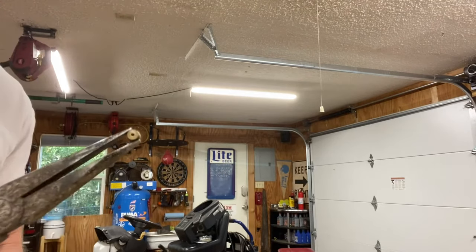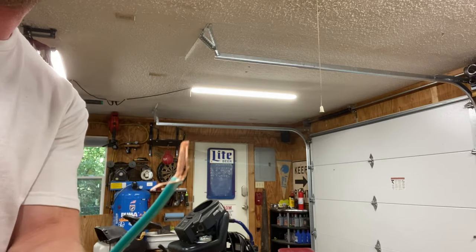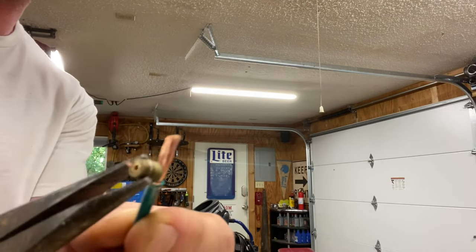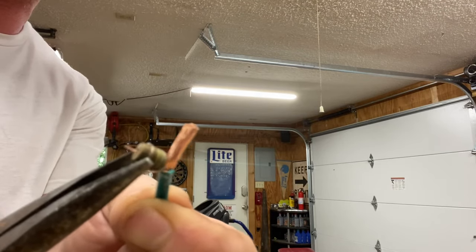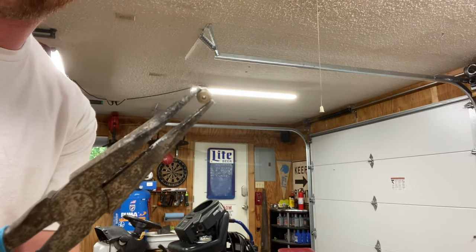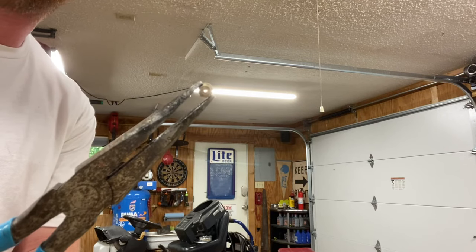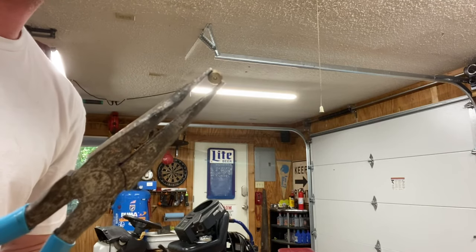So I've still got some more tricks in my book. How are we going to clean this thing out? What I've got is a piece of wire. Sometimes with these small carburetors, even the carb cleaning kits have just too much girth on them. So I just get a little piece of wire, shove it in there, and just clean it out like so. Then you shoot a little carb cleaner in there afterwards. Sometimes carb cleaner won't dislodge whatever's in there - that's where the wire comes in. Now look at what we got here - you see that light through there? That means we've got a clear shot all the way up to the motor. If you can't get them cleared out, start with this and then hit them with some carb cleaner and you should be good. Let's move back to that carburetor now that we've got this pesky jet figured out.